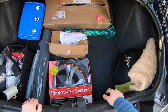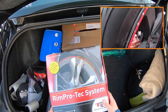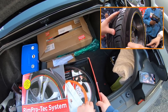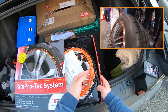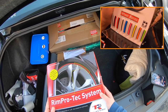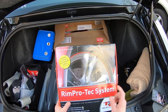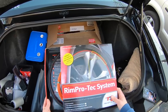This here is from a company I ran into at SEMA — Rim Pro Tech. These guys are based out of Australia and they have a really cool system that puts a five-mile-an-hour curb rash bumper on your wheels that doesn't look horrific. I'll go into this in another video coming soon. I got black and orange — these beads are interchangeable so you can do different colors, and you can replace them if you curb rash them. It comes with everything you need for the install: cleaning swabs, installation tool, and more. It requires 3M tape so it needs above 65°F to stick properly. Orange may be a little too loud for my car, but I went with it just to show that color options exist.